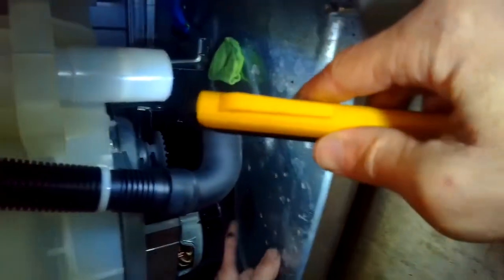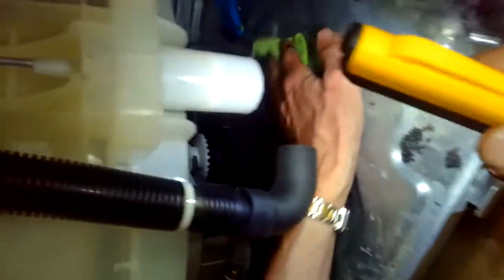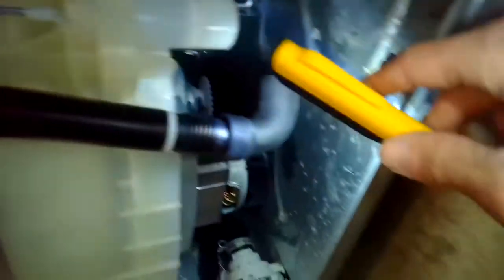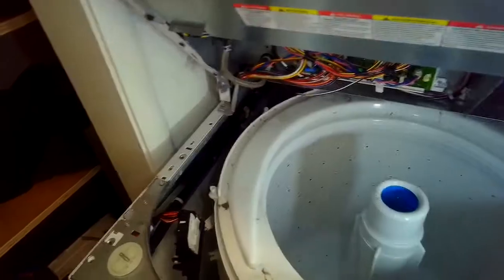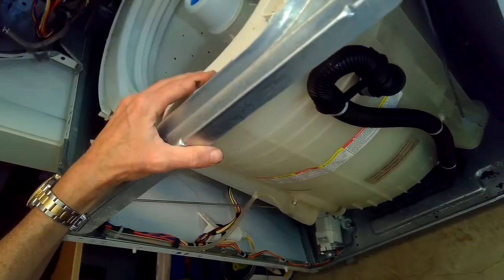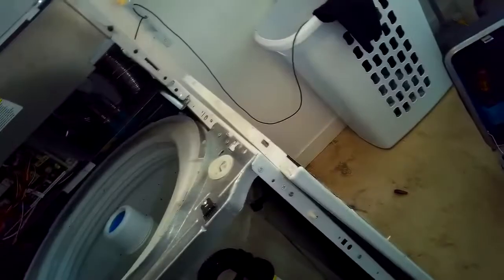Found a few extra socks in there — that's due to the machine being overloaded. This makes sure the pulley can spin, but when they get overloaded that's also when they can fall off of their suspension. We only want to load these up to the top of the spin basket and no further, and we only want to use it to wash sheets, towels, and clothing — but no blankets.